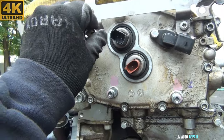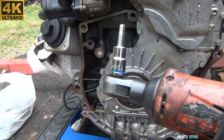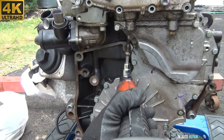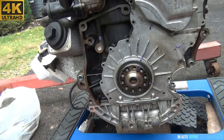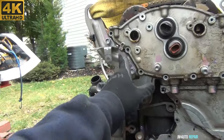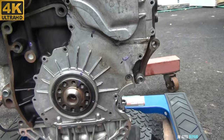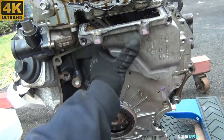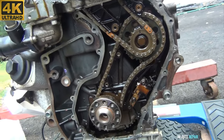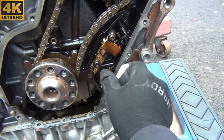It's very basic — there's also a 6mm Allen bolt here. I already took out the flex plate and you can see the marks still there. I painted the different bolt sizes different colors just in case. I already took out the upper timing chain cover and I'm taking out the lower timing chain cover right now. I can see a lot of debris, rubble, and pieces of the timing chain guides — no wonder this engine had timing overrun and correlation codes. There is a lot of work to do.